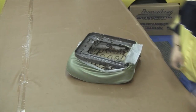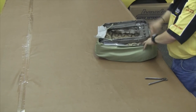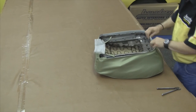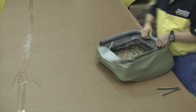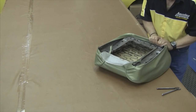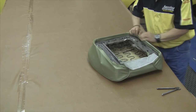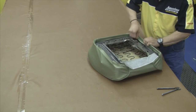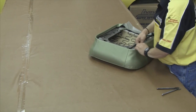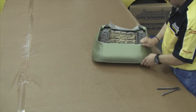Now before you attach the front three-quarters of the seat cover, you want to make that anchor hog ring. Pull your seat cover over the top. Now this seat traditionally has hog rings in this area, but this particular model has a small plastic piece that interlocks with the seat frame, so it's very easy to install. It actually clips and folds over the top of the metal and clips underneath into a channel in the seat frame. You can press the springs down while you're doing this.